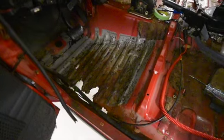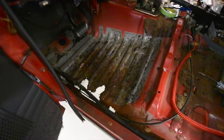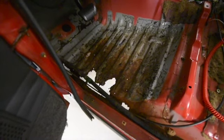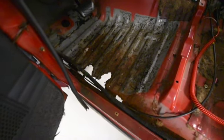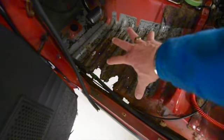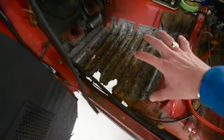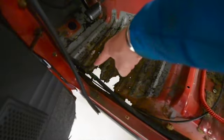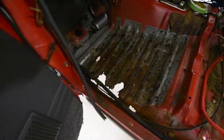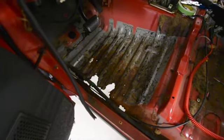One area is the front driver's side floor, which has a large gaping hole. We are going to be cutting out this floor pan and installing a new floor pan to address this rot. That's really the worst of it — the rest is in really excellent condition, but it's just an oddity that we have this right here. Maybe there was a leak down the A-pillar at one point that was causing water to sit and pool there. We'll be taking care of that as well.